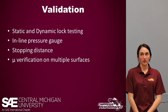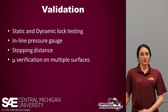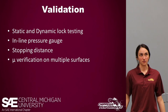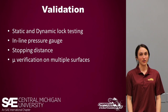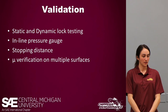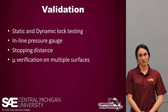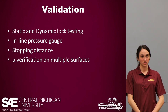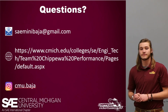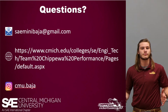To validate our braking we have static and dynamic lock testing, which is especially important this year to ensure all four tires are locking in the same way. We also have inline brake line pressure gauge testing, and we'll validate our calculator and stopping distance on various surfaces with various friction conditions. Thanks again for watching — if you have any questions please feel free to reach out to any of the contacts listed, and if you want to learn more about our team you can visit our website or any of our social media.